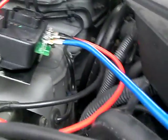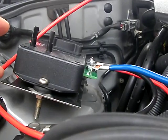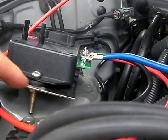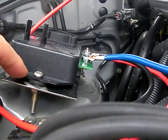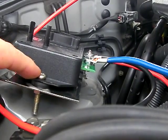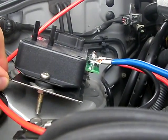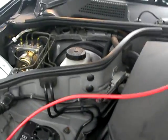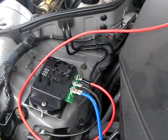I have the pulse width modulator attached to a stainless steel plate. It's attached to a bracket that was already in the car and it's mounted on rubber washers. The device isn't really touching the stainless steel plate — it's suspended between two screws, both with rubber washers in between, to keep the vibration down. It has a little bit of flex because of that, but it's very secure.